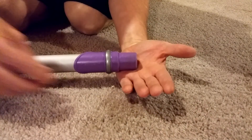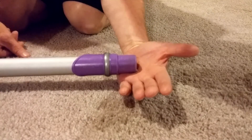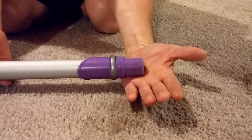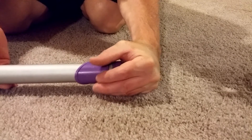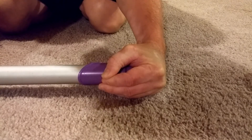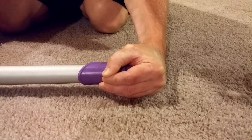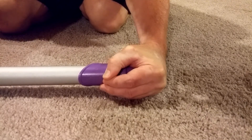Now I'm going to completely block up the hose, creating maximum suction and zero airflow. I'm going to completely seal this with my hand, and I'm going to turn the DC-14 on, and you're going to hear it rev up. And if I've done it right, you'll hear the suction relief valve click. Then I'll remove my hand and we'll see what happens.